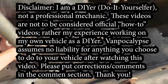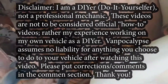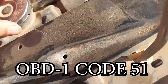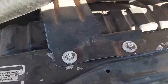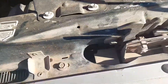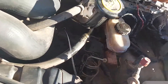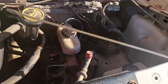Welcome back to Van Apocalypse. Today I'm working on my 1988 Ford Econoline van. I had a code 51 — OBD1 code 51. If you want to know how to extract codes from an OBD1 vehicle, check the link in the description. This is the second video in this series. I'm going to change out the ECT sensor — the engine coolant temperature sensor — which is what code 51 indicates: it's reading too high.